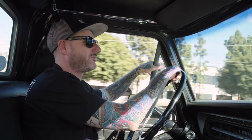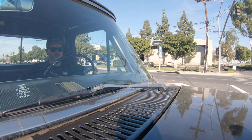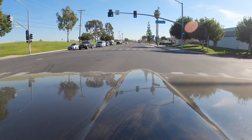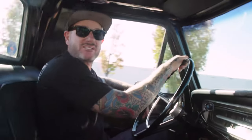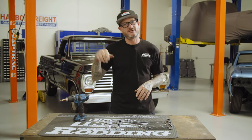A couple days' work, since we waited for some parts and had to change out a few things like the throttle and the linkage. Got rid of all that old throttle linkage, which was no good for what we were doing. But now I feel good because the truck's downshifting like it should. We've done AC in this thing, and now we've got an overdrive transmission — no more three-on-the-tree, no more clutch. It's getting more and more comfortable to drive. I think the next thing we're going to do is a tilt column with power steering — that will give us a quicker steering ratio and power steering. We went with the 200 4R transmission from Phoenix Automatic Transmissions, and man, it's nice to drive. We just finished installing that 200 4R into our F100 and boy am I happy — the thing was smooth.